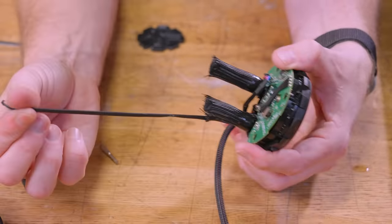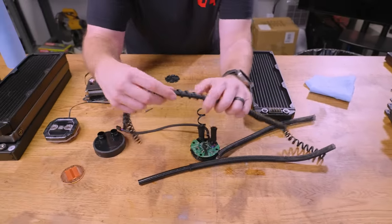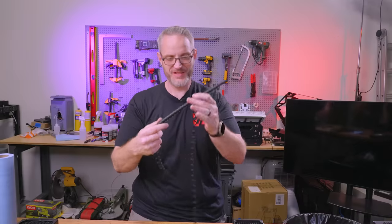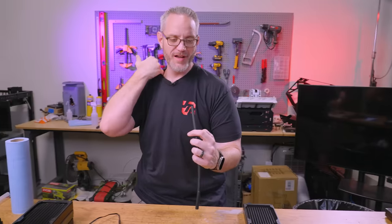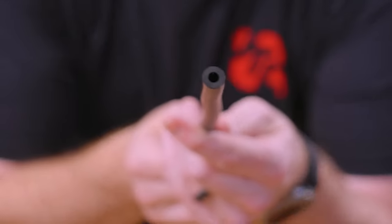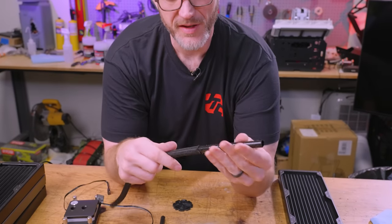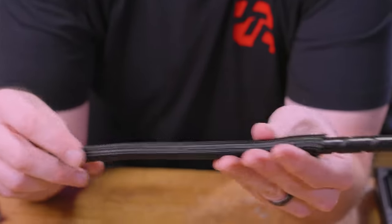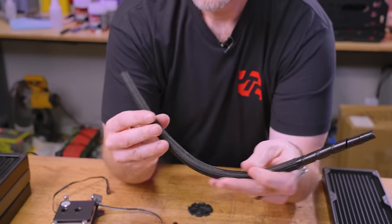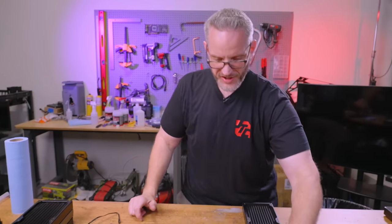This particular AIO had the wire going through the tube, which is nice because it hides the cable. This is the actual tube — there's a lot of length of cable if you stretch it out. This is the diameter of the tubing — only about a quarter inch, though very flexible. It had a protective sheathing on the outside as an anti-kink measure, and then sleeving over top of it. So although it looks super thick, the inner diameter isn't a lot. Pretty much every single AIO is about a quarter-inch inner diameter.